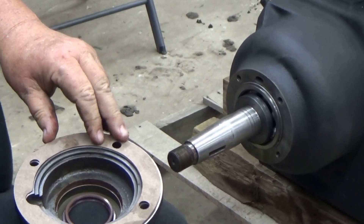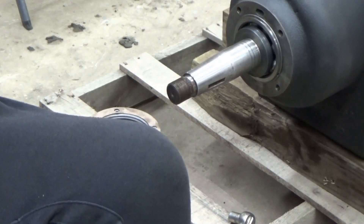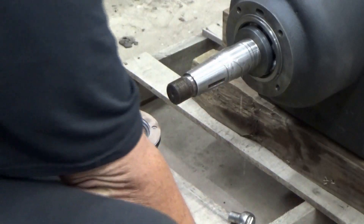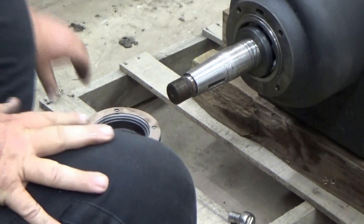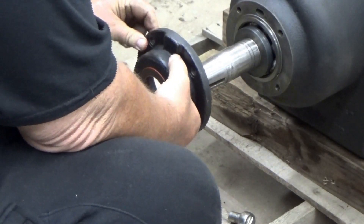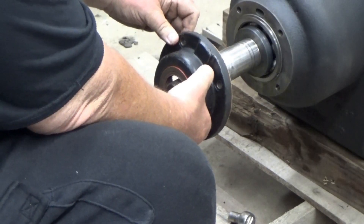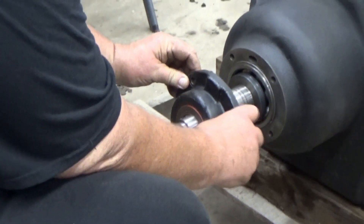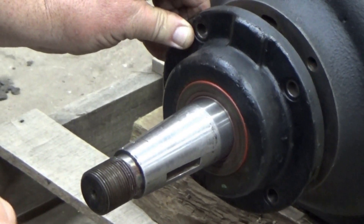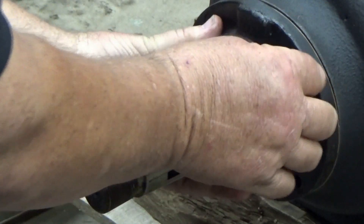Now, there is a right and a wrong way for the gasket, and that's pretty obvious. Why do you put the oil on the shaft instead of around the little ring? To make you ask questions. And folks, that's why I do laundry so often — because that was a rag he didn't just use; those were his pants he just wiped that oil on. Be very careful you don't get the seal on the threads — you don't want to tear that seal. Slide it right straight up on there. I'm going to take a bolt with a washer and put it through the hole so we stay in place. That holds the gasket so it doesn't crinkle too.